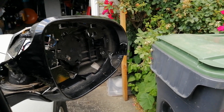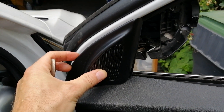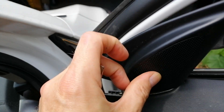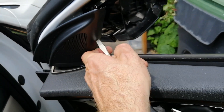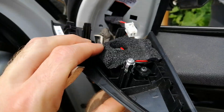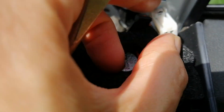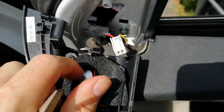Please see the link in the video description for the replacement part. There's this little speaker here in the panel that you can just stick a screwdriver behind and pull it right off. There are these little tabs that come out — that will easily come off — and then you just unplug this wiring harness. It just has a little button you push down to disconnect it.